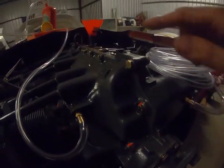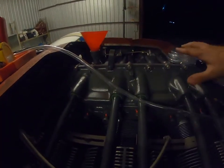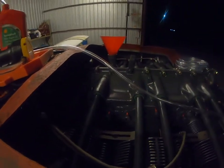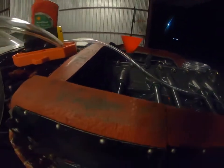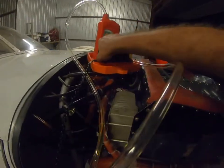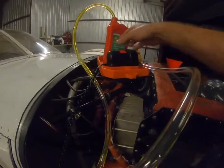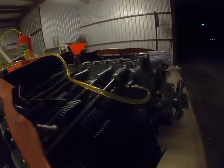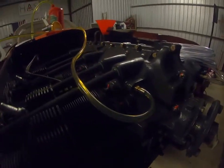We'll let it rest and just keep pumping — a few quarts through the engine that way. That'll oil the bottom end and get oil fed to the mains and the journals, so when we crank it it's more like we just shut down the engine not too long ago, versus having a dry system.